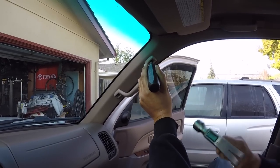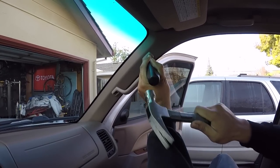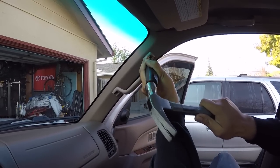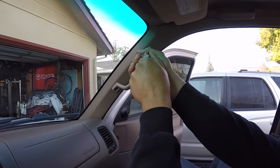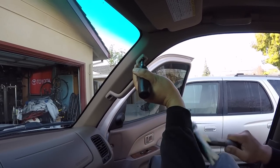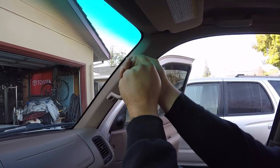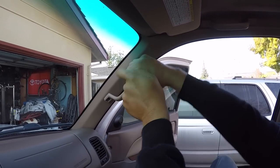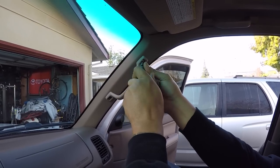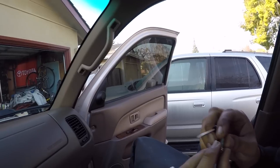Now he's changing it to loosening — to the left. It moved, but it's still tight on there. It's working. He's getting it — the impact driver did it! Definitely try giving it a strike in the tightening direction first, then go for the loosening. This worked really well. You can see all that Loctite on there — they used a blue Loctite, and it's not like typical blue Loctite 242 that's easy to remove.